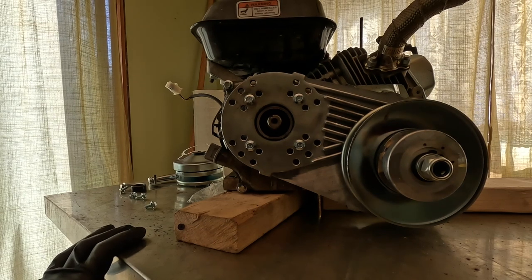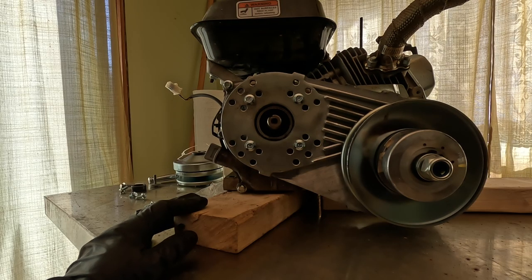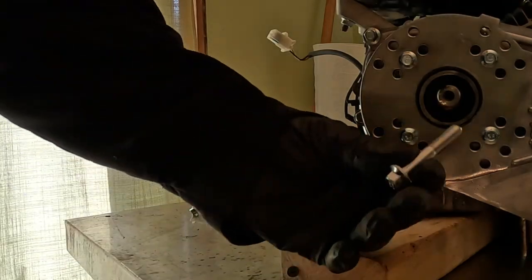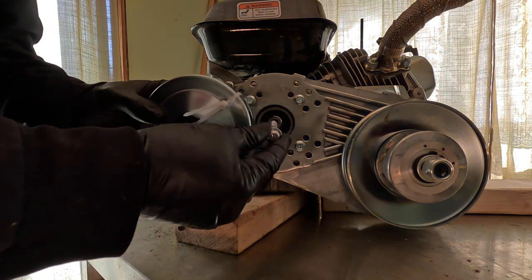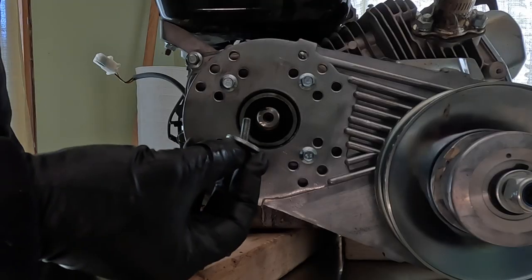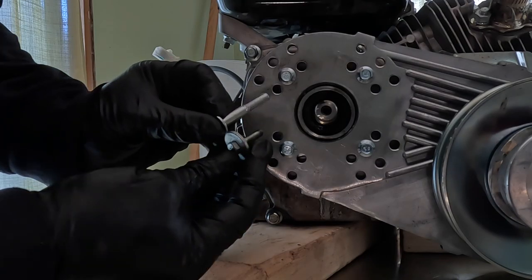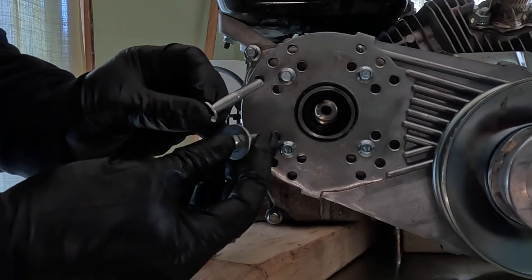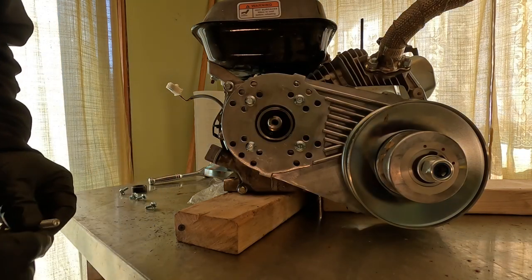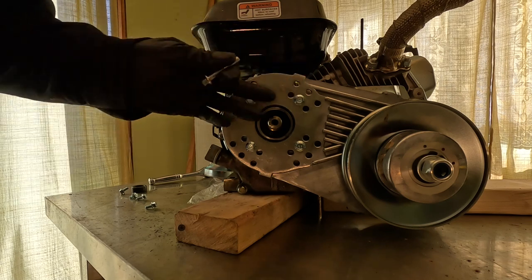After I've got this all worked out and on the scooter and test-driven, I'll do another disassembly and put blue Loctite on this stuff to stop the bolts from backing out. There is one thing I read about this kit with this particular high sun engine and the 16 millimeter shaft: they provide a long bolt that's supposed to hold the assembly onto the snout of the crankshaft, but it's the wrong thread — the bolt's too thick. I'll need to go to the hardware store and get the smaller diameter bolt in the right length, but that's no big deal.